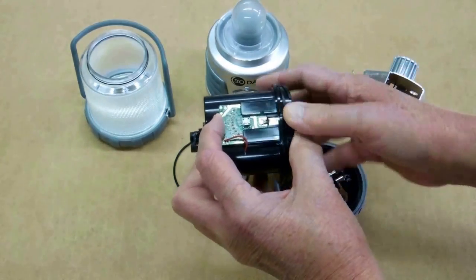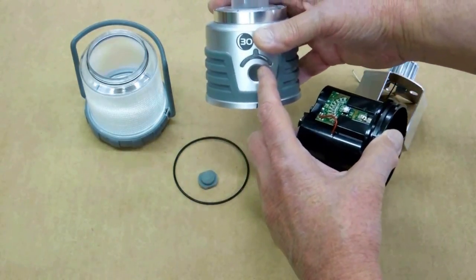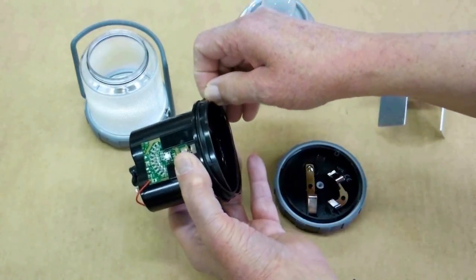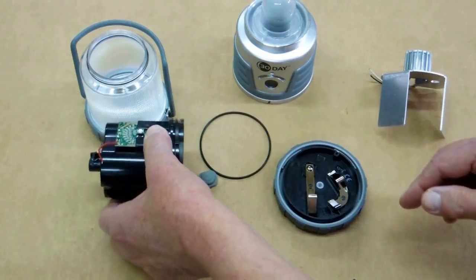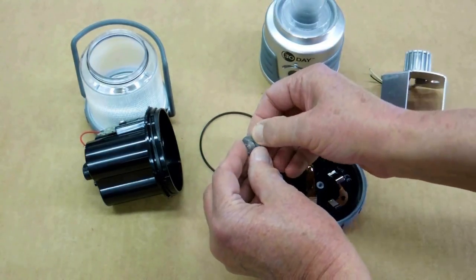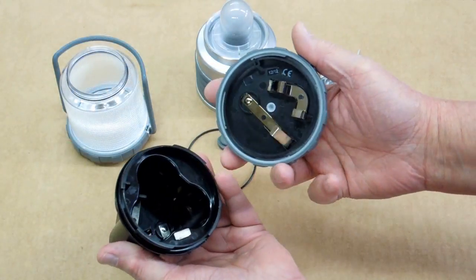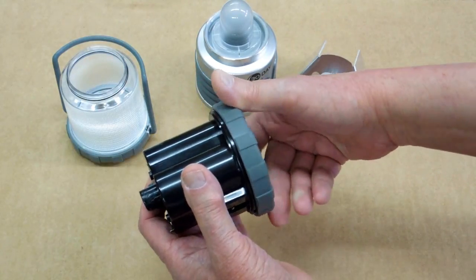This switch has to be in the center of this hole, and this row of LEDs is the indicator light to tell you what the setting on the light is. There's an O-ring that goes around here — you want to take that out and clean that groove because alkaline solution had gotten down in behind it. The switch pops out of here easy enough and it's actually made up of three pieces: two pieces of plastic and silicone. Took those apart and washed them with soap and water, washed the O-ring with soap and water, and let everything dry. There's only one way for the base to go on here — there's a hole here and a bit of a protrusion on this side. Those engage, and then this can screw together.